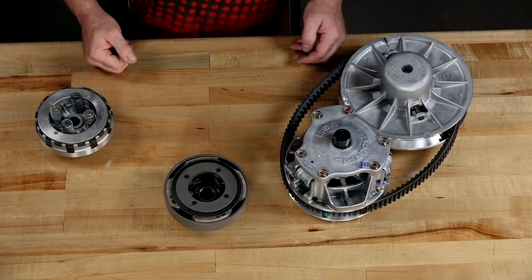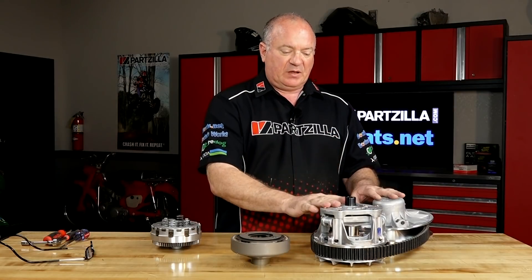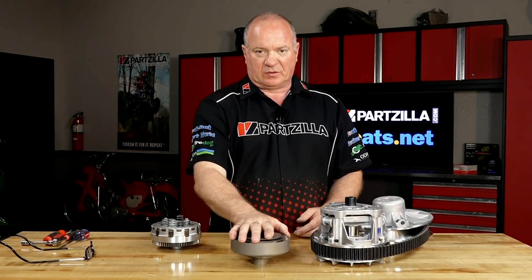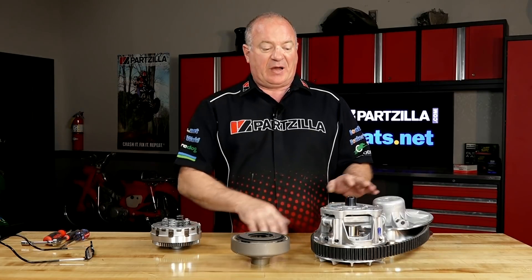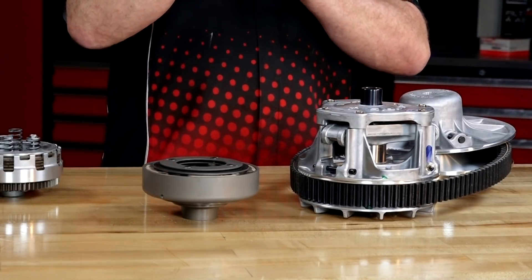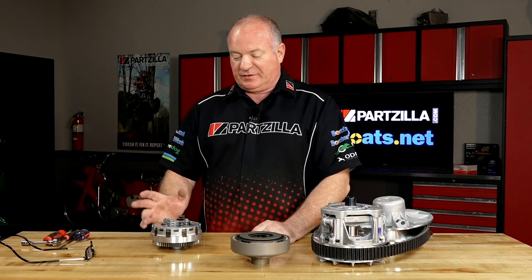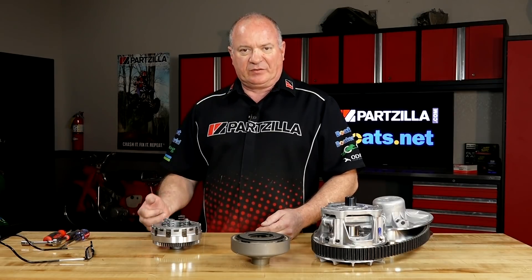Let's look at a different hybrid system — the Yamaha Grizzly actually uses a sheave type system joined with a centrifugal clutch. The sheave system is in constant motion on both the drive and driven clutch, but forward momentum is halted by the centrifugal clutch that must be overcome before the machine moves forward. Now the Polaris system doesn't have any other clutching system other than the sheave. The engine drives it, and it drives the transmission, but they have it set up so the engine can rotate with the belt basically floating until enough RPMs cause it to grab the belt and move. The most common standalone system in powersports is the standard clutch basket and pressure plate disc system, found on basically every motorcycle and every sport ATV.